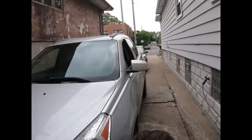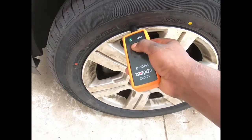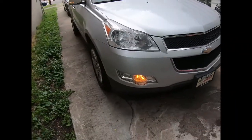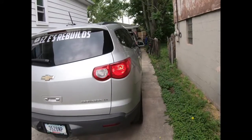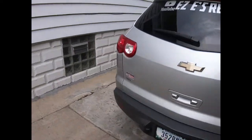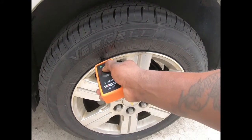The car will position you to the right tire — there are no other warning lights on. All you want to do is put the tool up to the tire, right up under the valve stem. You can see the back tail light is on showing you which tire to hit next. The car honked and it's positioned me to the last tire — tail light is on. I put it up to the valve stem and the car should honk twice.